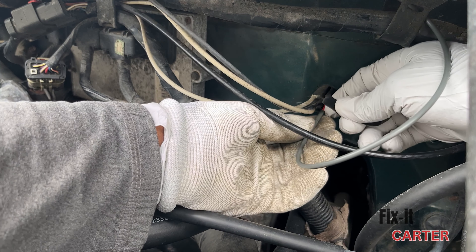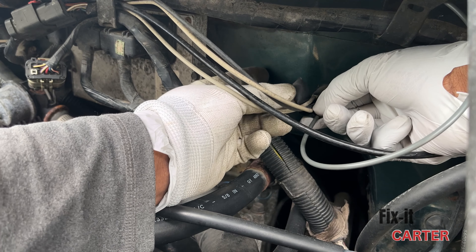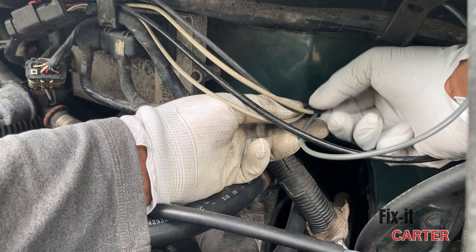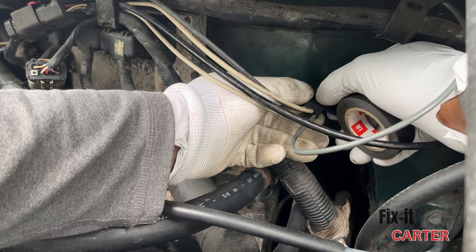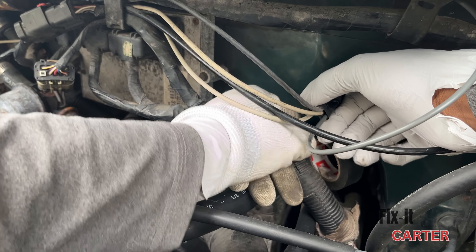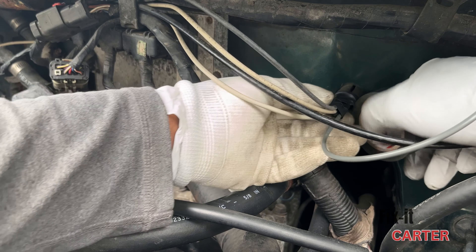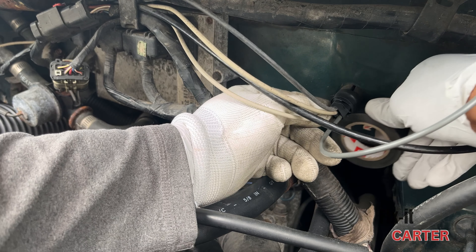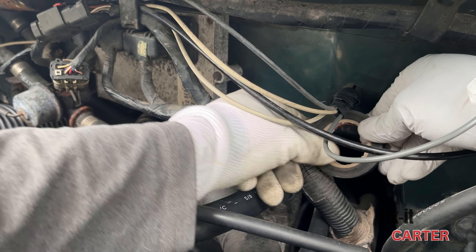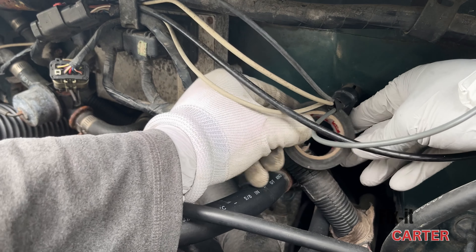There's no special method to this one — I'm going to wrap the tape around the original holes and then wrap around all of them. After that, I'll go additionally and start wrapping around the whole assembly, starting with the grommet and then going around the hoses just to create some stability. I still don't want to put too much tension on these hoses because they are sturdy but also old, so I don't want to stretch them. This also serves as a means of leak protection, especially here at the firewall where it's common for these to break off.